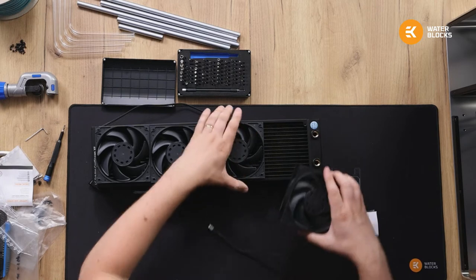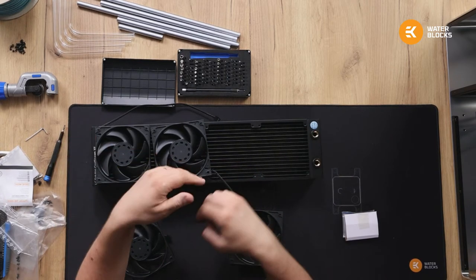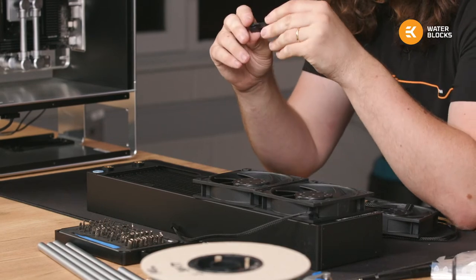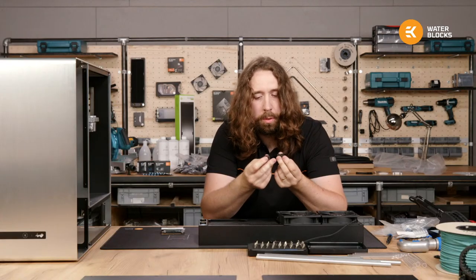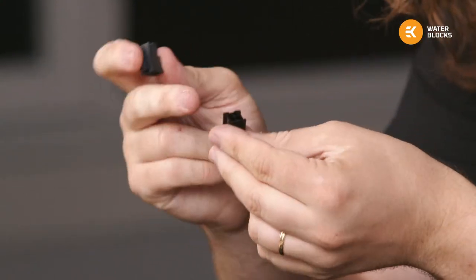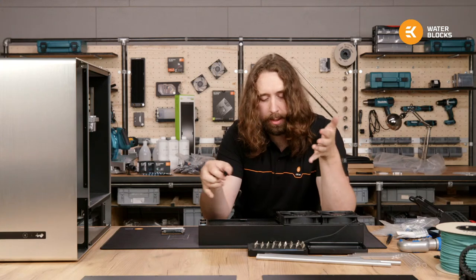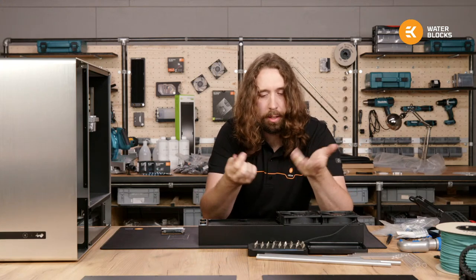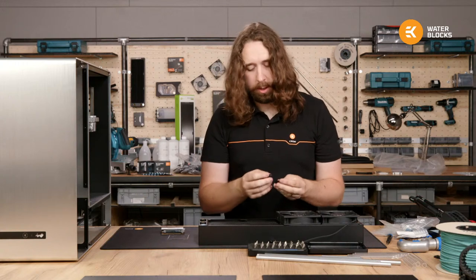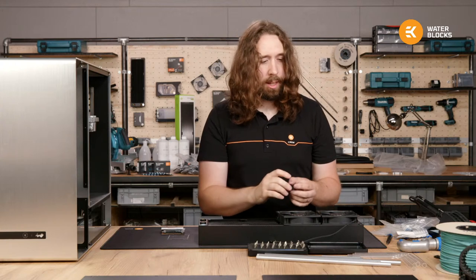So with the fans, my plan is that I will mount them all on the radiator, take all of the cables, cut the end off every single one, solder the leg pins together, and use these male-female ATX connectors. So this is like a 4-pin EPS, the same as you would use for power on a motherboard. I need 4 pins, one for each wire, although I will only use 2 of them out to the power supply. And then if I ever want to swap fans, or clean the fans, I can just disconnect and change each side to suit, and I will make a permanent extension cable that goes off to this power supply specifically. So no connections beside this one. It's a really good one because it's locked together, they won't fall apart.